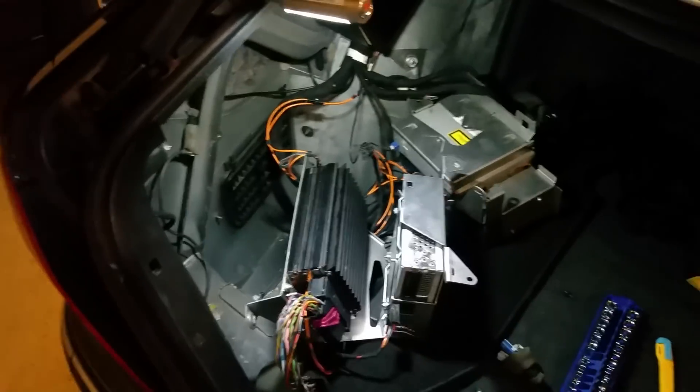The problem is — just like my car — these trunk wells down in here tend to collect water. I removed the little plug on my trunk well so it could drain. But the water gets in there, comes in through the taillights sometimes, fills up, and gets into the bottom of what's called the audio gateway.